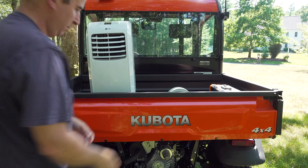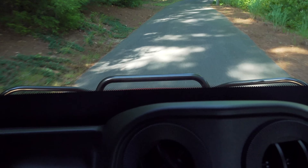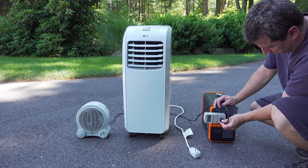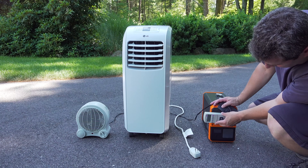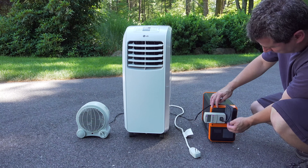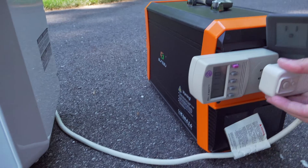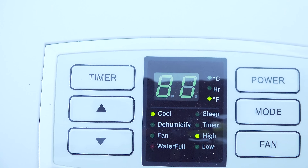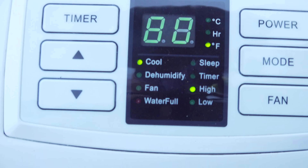To make sure that wasn't a fluke, I decided to do the test a second and even a third time. I went back to my driveway, plugged in my wattmeter, and ran the air conditioner since it's usually the one that most things have trouble with. Again the results were the same — the compressor fired up and this thing really didn't know the difference whether it was plugged into a wall outlet or this battery generator.